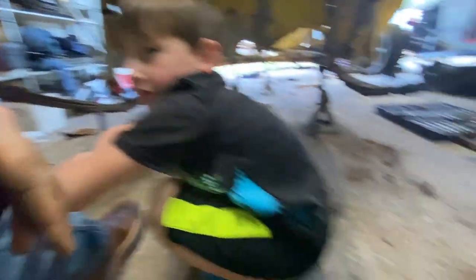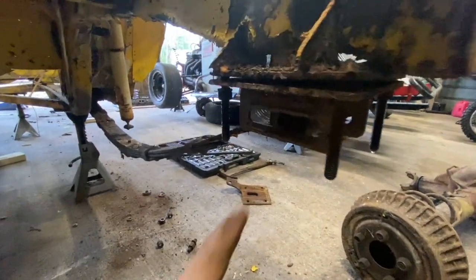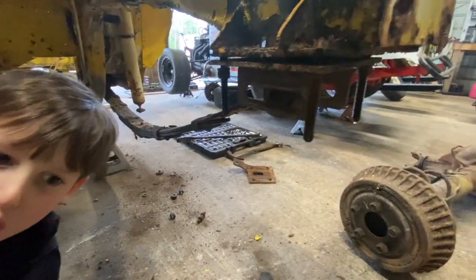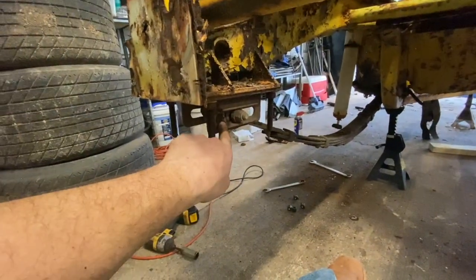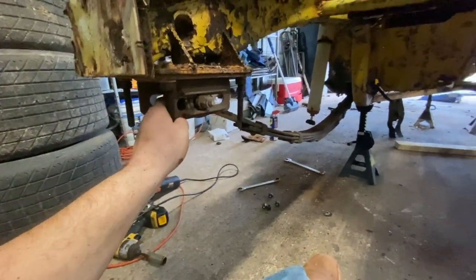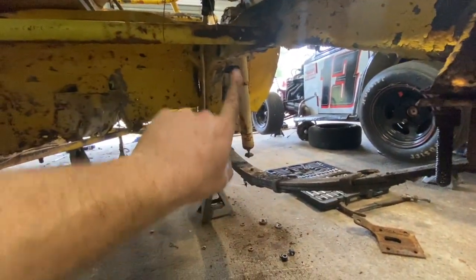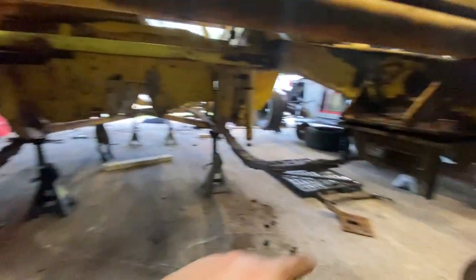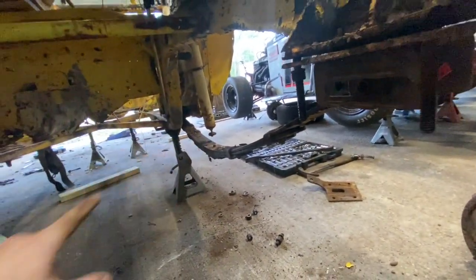I have no deep socket long enough to go over this right here. But you can see these are on some kind of sliders to move the leaf spring back and forth. These are illegal, so I've got to take these off anyway and put the stock ones back on. I cannot have these adjustable rear ends like this. The next thing to do is to unbolt the upper shock mounts, drop them out, and get these babies off where I can get up there and get the fronts off.